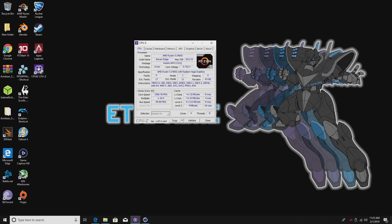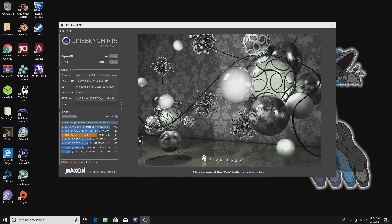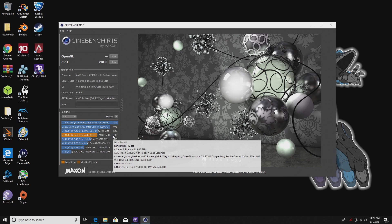I've installed Windows 10 Pro and updated all the drivers. I was able to overclock the RAM to 3000 MHz in the BIOS. There are also overclock settings for the CPU and GPU, but none of it's sticking — the chipset we're using just really isn't overclockable. But maybe down the road ASRock will put out an update and allow us to overclock. Got my fingers crossed.